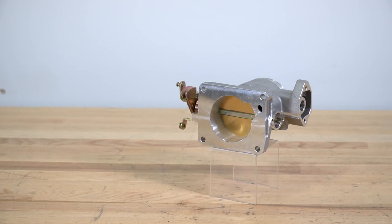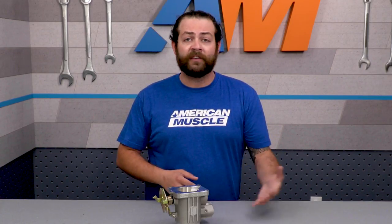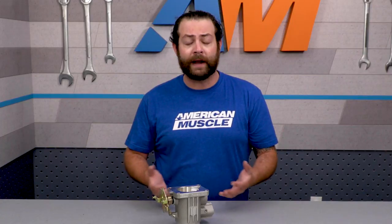When it comes to moving air into and out of your 5.0, there are a few general rules. Cold airs, throttle bodies, and intake manifolds coming in, and you've got long tubes and a cat-back moving it out. Some parts have a tendency to move air more effectively, like long tubes compared to a pair of mufflers. If you've done both and also have some other air or exhaust mods, then you're literally looking at where your power bottleneck is — and it's usually the stock restrictive throttle body.